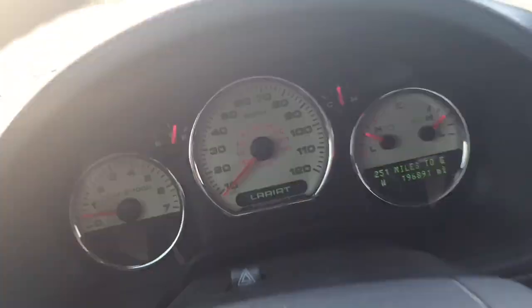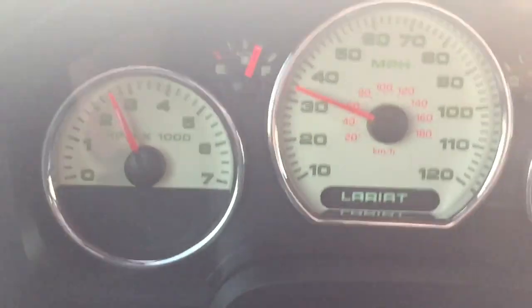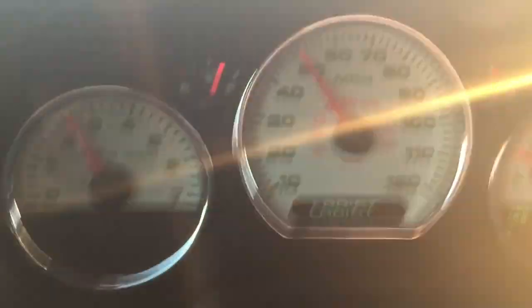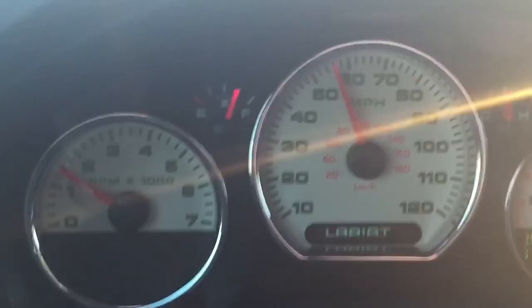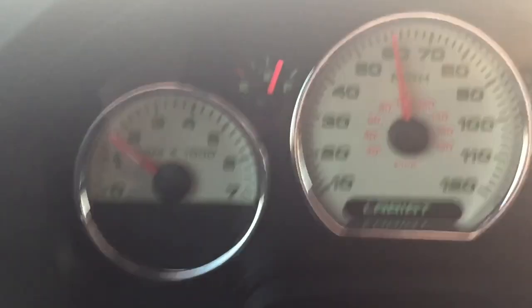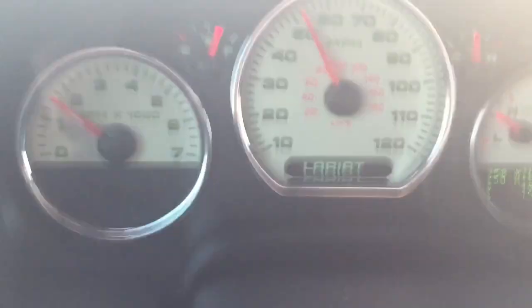The truck is fully put back together. I've driven a few miles so far and it appears to be driving great. I guess it was just that clip falling off and getting broken up inside the valve body, because it's shifting great now — it drives so nice, and it goes straight into overdrive too. There's fourth, there's overdrive. Man, it's driving great, could not drive any better. That was definitely the problem, and I'm glad it didn't break anything else inside.